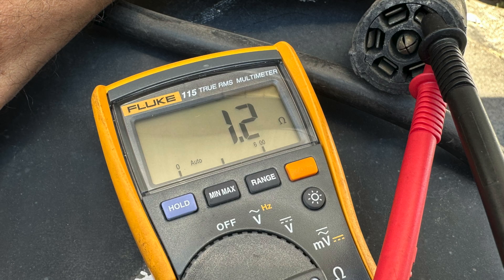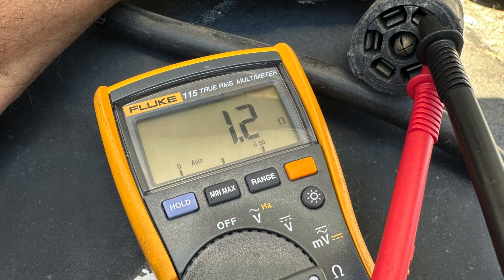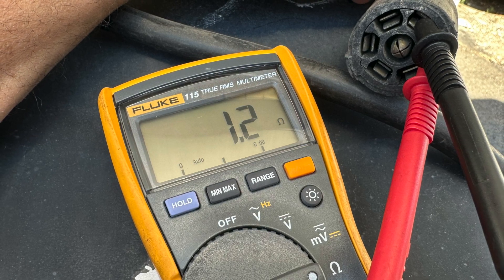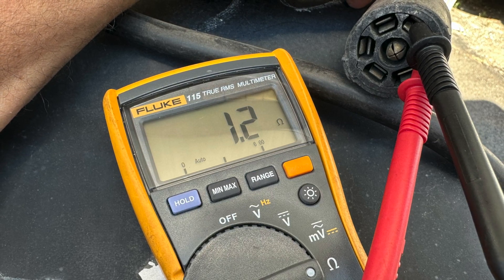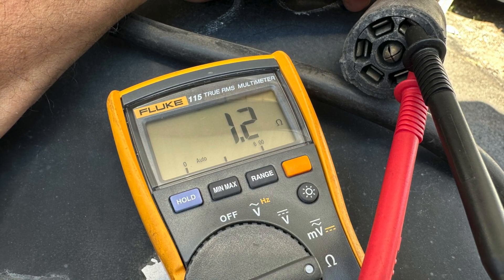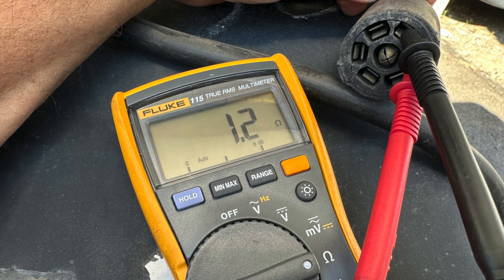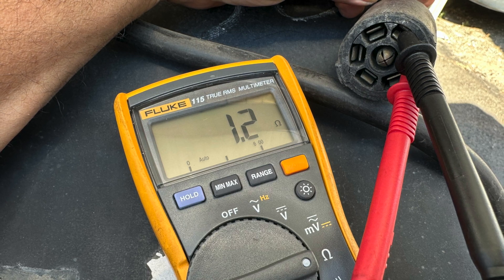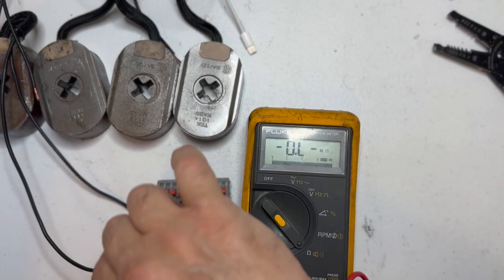When I see weird things at work it inspires me to make videos, and this one's going to be about the resistance on brake magnets. You can see here I'm measuring the resistance of this circuit at the seven-way — the bottom two, one's the ground and one's the blue wire, your brake wire — and I'm reading about 1.2 ohms. You should see about one ohm. If you were seeing three ohms, that's probably telling you you're only seeing one brake magnet, so there's probably a wire broken somewhere. I've seen them corrode and break right out of the connectors.